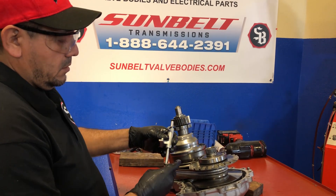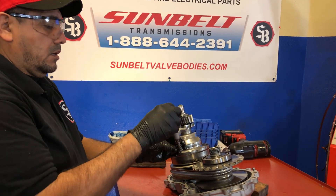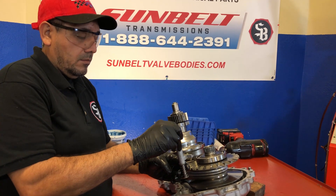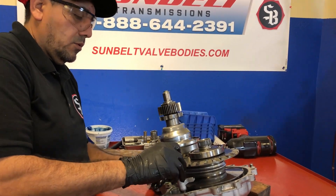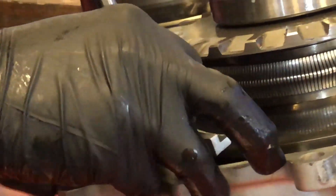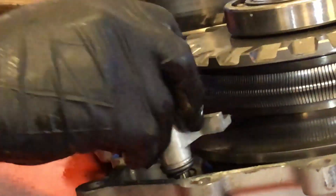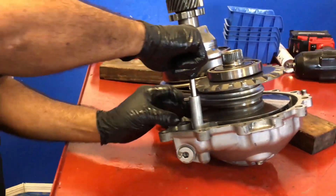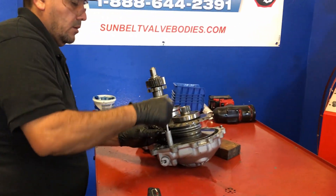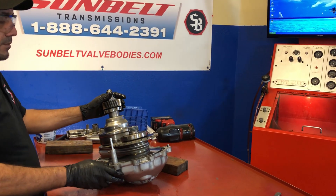What he's installing is the guide for the stepper motor guide. You need to put this in the cover — it goes spring first, then shaft, and then you've got to catch the lip of the secondary. It's got it in place now. All right, our variator now is ready.